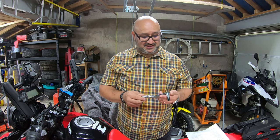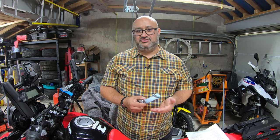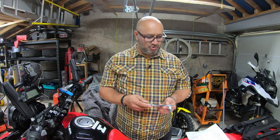I think it is a really good product. It does a lot of things and saves several tools. If you don't already have a toolkit specific to the bike, this does a number of things. But what you don't want is to get out on a trail, get a puncture, and realise that both the rear axle and front axle are done up way too tight and you've got no chance of getting them off because all you've got is this. So like I said, it's mentioned on the website — read the notes there. In terms of price I think this is priced really well. If you've got a CRF250 or a 300L or Rally and you're looking for one tool to do the awkward things like the 24mm nut for the rear axle and the 14mm hex for the front axle, I think this is a winner. I'll put a link to the Rally Raid website and in particular to this tool with the mini spanner in the description. I hope this has been interesting and useful — if it has please like and subscribe, and I'll see you next time. Thanks for watching.